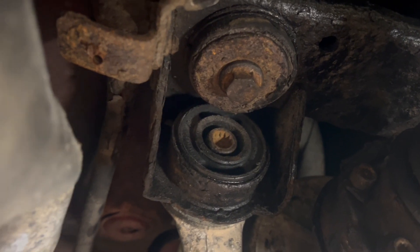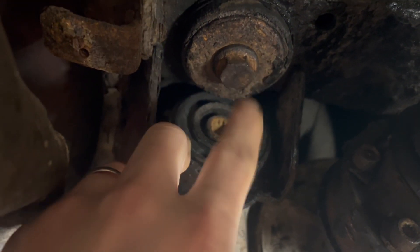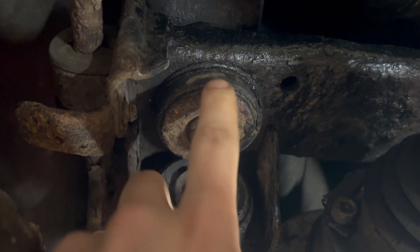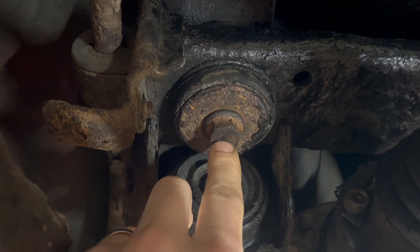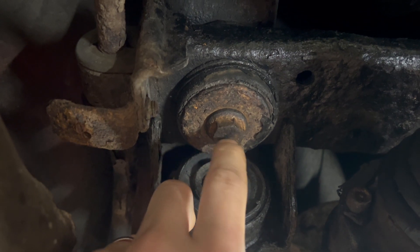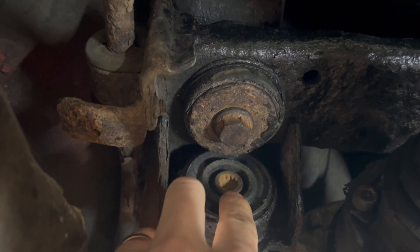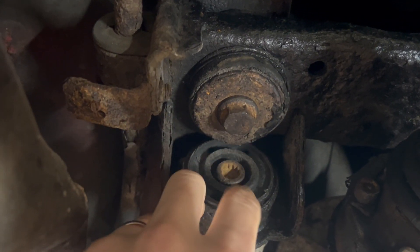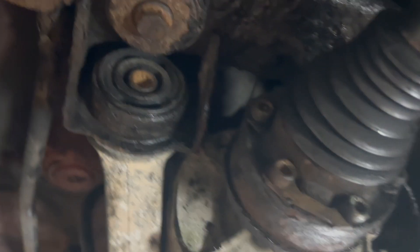The other mounts: access is tight, and you can see there's a subframe mount just literally right above it. You have to take this out, and just be careful because that is a captive nut. If anything's going to go wrong in this job, it's that snapping or breaking the captive nut loose. I was very nervous about taking that out. I couldn't see any other way to get at these with the tools I had without taking that off. Fortunately it went okay, and I was able to get these bolts out and drop the whole mount out.